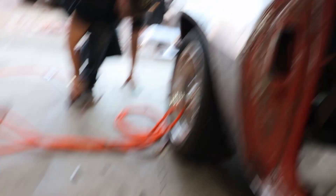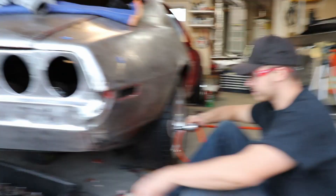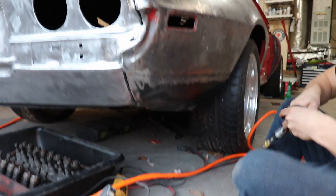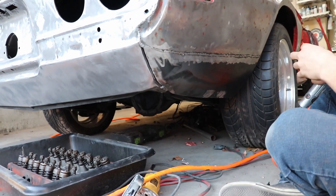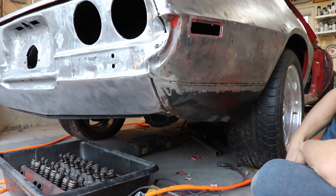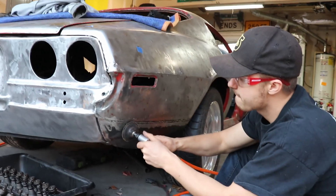When the guy's getting a little lazy, he's going to have to come over here and grab himself a nice dolly seat — going to watch all this madness go on. All right, let's see what we've got going on over here. We did weld on a new quarter panel — the lower quarter panel at least. You can see the black part. That's a little patch panel down in here, and a new tail panel on there. Some of the body work is cleaning up some of the welds from tacking everything on.